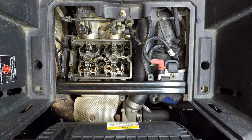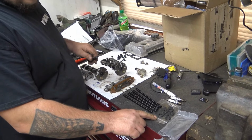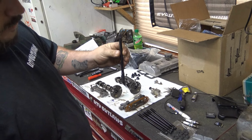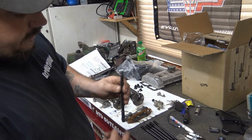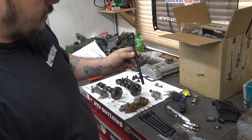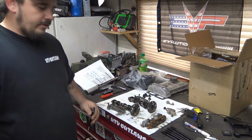All right, so put some lube on the backside of both washers of the heads for the head studs. This is the spot. This is what's going to go down into the block and bottom out. You don't go crazy on this. You just hand tighten it down in there till it stops. And I'm just going to run it down in there. It's got an Allen. Run it down in there and put a little on here so it makes less resistance as you're trying to tighten it up.